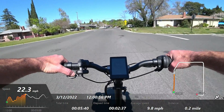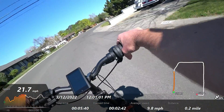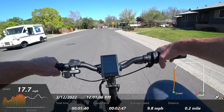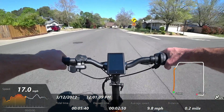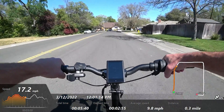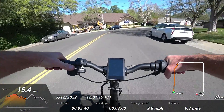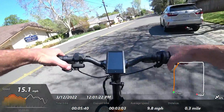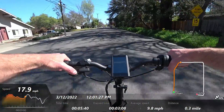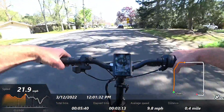I still have more to go if I wanted it. I tend to use the brake cutoffs instead of a gear shift or pedaling backwards to manage shifting so you're not shifting while it's under power. Now I've just gone into the highest gear with that 46 tooth in the front, and I'm going to give it some throttle — just gentle — and the pull is just wild.